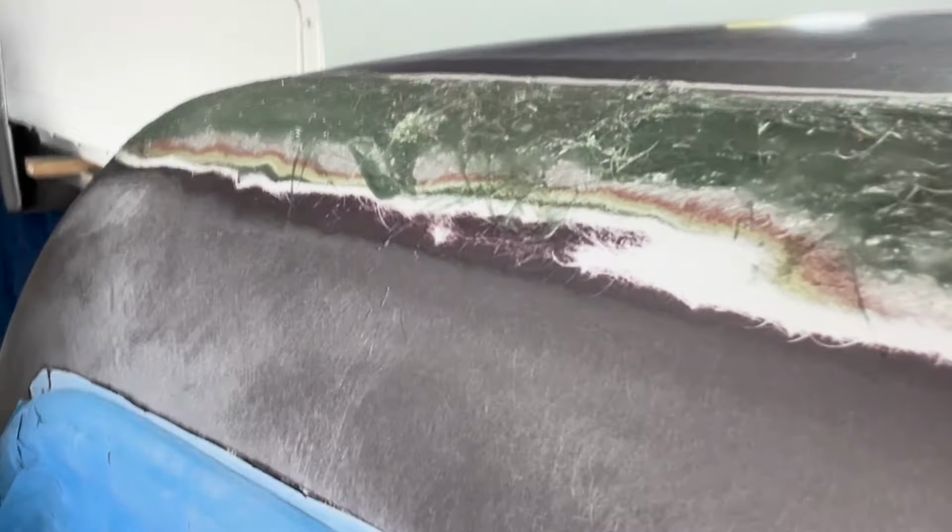And it was no joke. So what I didn't know, in that seam, is they lead it from the factory. There's lead in there. You can't see it. Maybe a little bit in a couple locations you can see it, but it's very, very dangerous to weld lead. It splatters, and the fumes are very toxic.